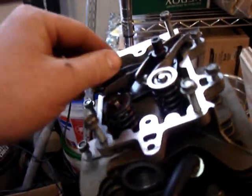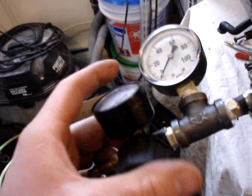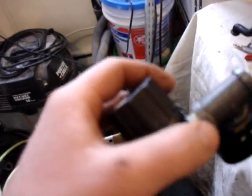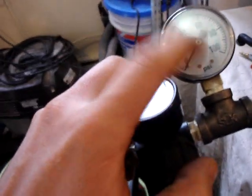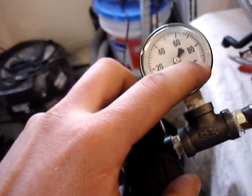Because I'm about to perform a cylinder leak down test. You set the cylinder at top dead center and keep the two valves closed, which I've done here by taking the lifters off. Then you actually fill the combustion chamber with air. You have this regulator set to 100 psi, and this second regulator will tell you the pressure inside the combustion chamber. There's a little male-to-male coupling between these two gauges that I filled with JB Weld to completely seal it, then took a 40-thousandths drill bit and drilled a tiny pin hole between the two. That allows enough air to fill the cylinder but not so much that it affects the second gauge. So with 100 psi of air coming in, this gauge will tell you the psi of the cylinder, and the difference between the two will tell you the percentage of leak down.